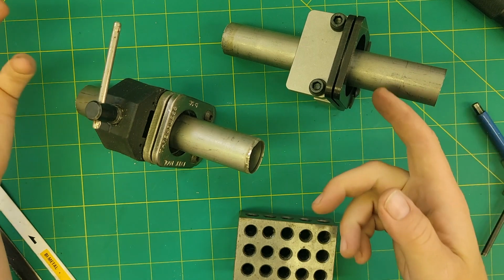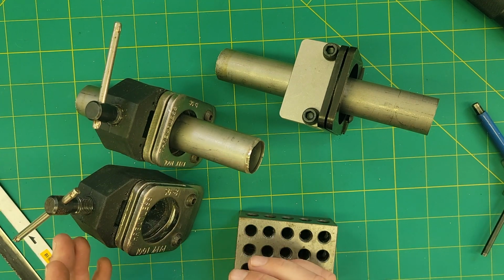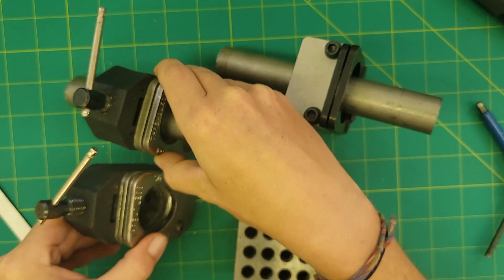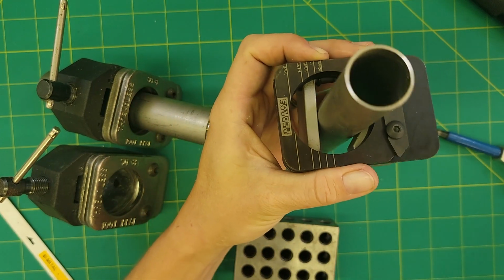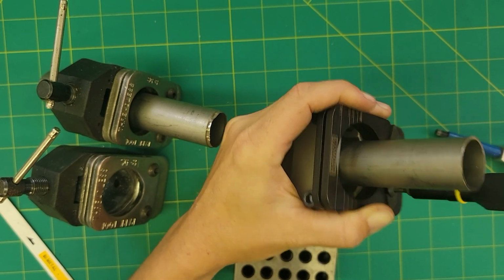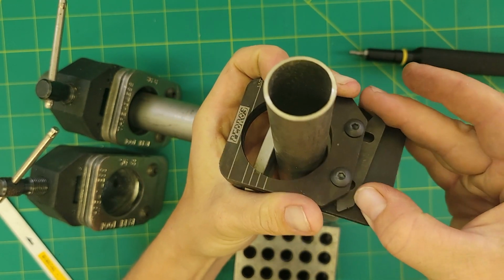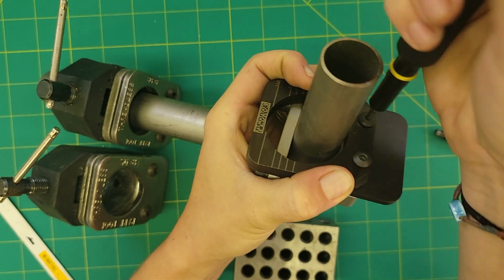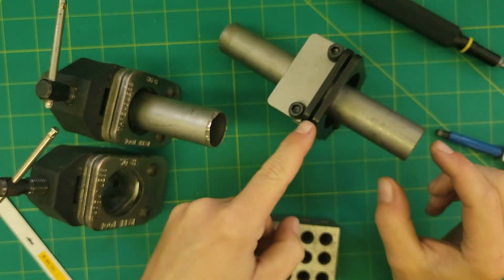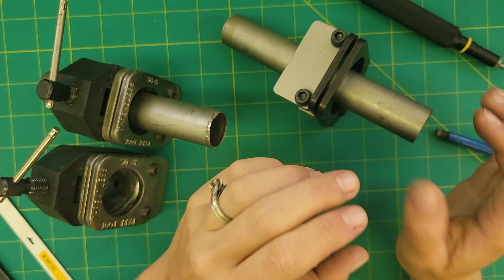Do I wish that the Pedro's one had a quicker connection? I do, but not at the sacrifice of accuracy. The other thing is, this is 2 Park Tool tools. One is the thicker one so that you can pass through with like a carbon fiber blade. The other is the thinner one so that you can use a regular metal blade. Pedro's actually went through this a little bit differently and has this shim here that's also made out of metal. So you can actually take this piece out, slip it in here. Not necessarily that you have to do this with the tube installed in the guide. You can probably do it better without that. And tighten it. Now you have the thicker so that you can put a carbon blade in there if this was carbon fiber. You can also take the shim back out so that you can have the thinner blade. So one tool does both things.